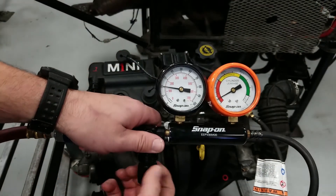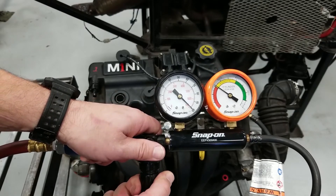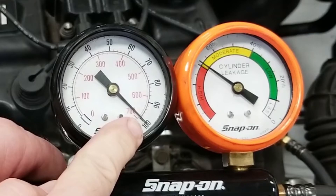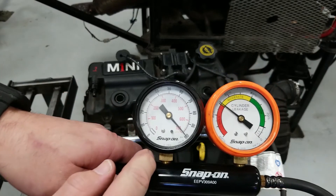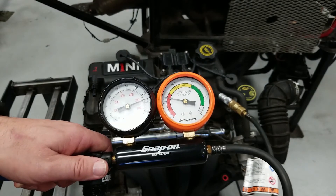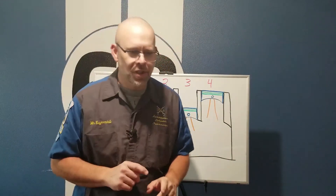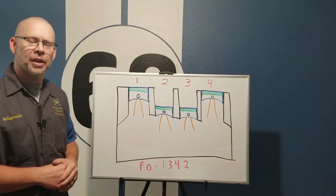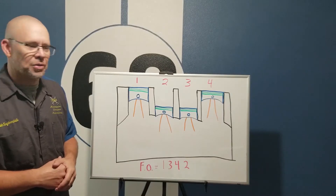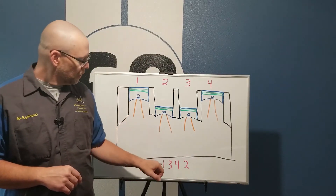Back into cylinder number four, we repeat our steps and crank the air pressure up again slowly. We're at 100 psi and — uh oh — we have a lot of leakage. Looks like we're right about 70% leakage. That is far too much. Did anyone catch what was done wrong here? If I'm testing cylinder number four, why did I put the screwdriver in cylinder number one? Companion cylinders — remember those? Hopefully you've already covered that.